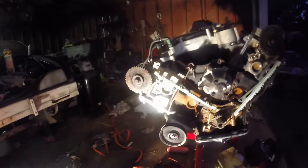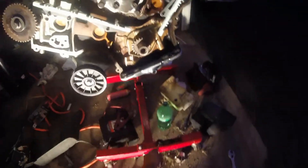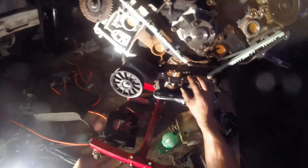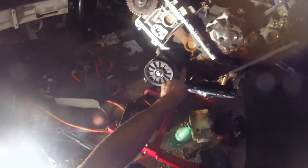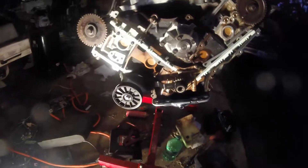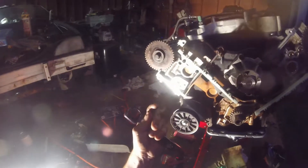What we're doing today is putting the timing chains on the old 4.6, and Doug brought over a tool to use. It's to set top dead center on your engine for the crankshaft. It just slides on to a dowel pin on the side of the block here for the timing cover, which makes sure that your bottom end is at top dead center. Super nice tool.